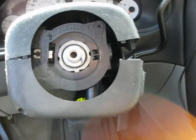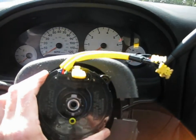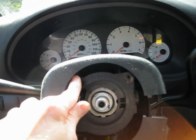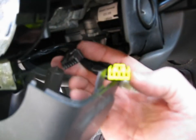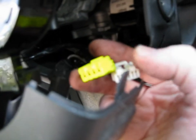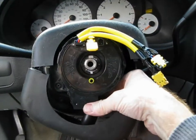Make sure your turn signal is in its neutral position before proceeding. The new clock spring drops into place easily. There's a little alignment pin up top — first line it up with that alignment pin, then do the two screws. Grab the wire harness — the clock spring only takes two plugs; the third black plug is for a feature not on my base model van. The yellow and white plugs are keyed completely differently so there's no risk of mixing them up. Plugs are in and snapped.